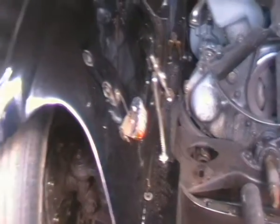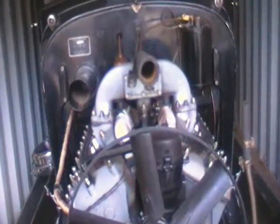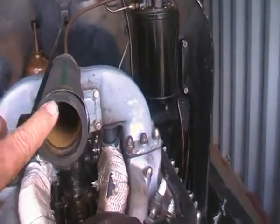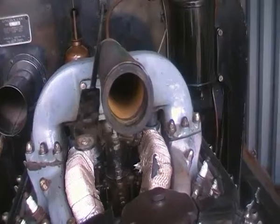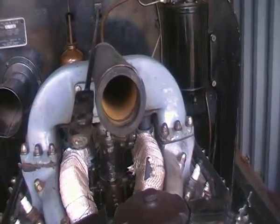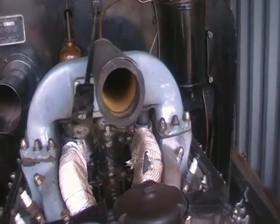The chap at present is down there rebuilding it for us. Now we're going to back-flush the engine — I'm just making a preliminary here — we're going to put a hose on here, extend it, bring the car forward, and we're going to blow compressed air and water through that particular intake there and try to reverse flush everything out of the block. I'm pretty sure there's a lot of rubbish in there, so I'm rather looking forward to seeing that happen very shortly.